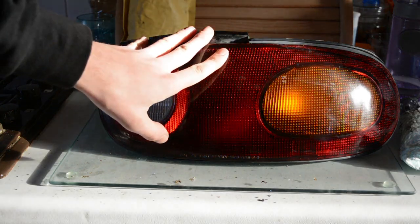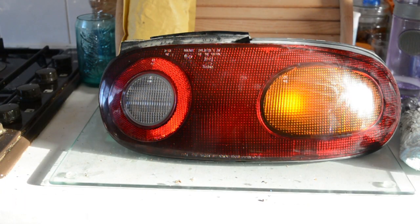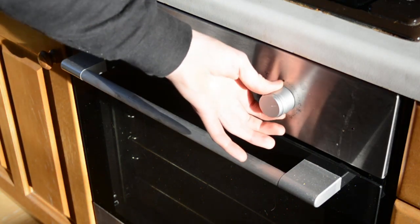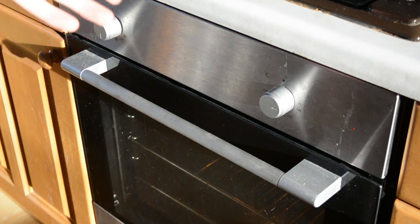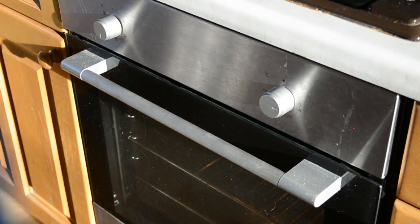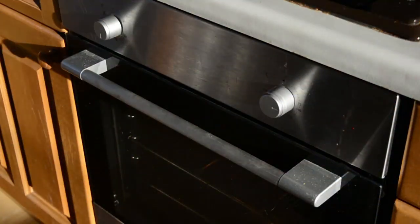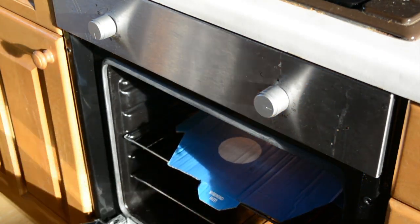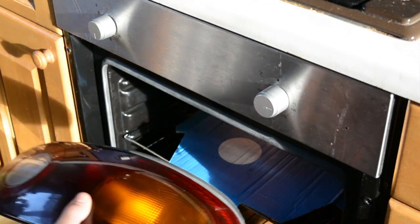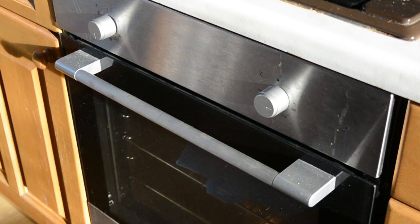Now we need to turn the oven on. I'm using an electric fan oven so I need mine at 100 degrees. If you have a different oven there are other YouTube videos explaining temperatures. We're going to get a piece of cardboard — I'm using the lid from a Domino's box — pop the tail light on top, and slide that into the oven. That way none of the plastic should melt. It's just a little precaution. Once the oven is up to temperature, slide in the cardboard with the tail light on top — don't put it lens-down because you don't want the lens to warp. Set a timer for about 10 minutes.